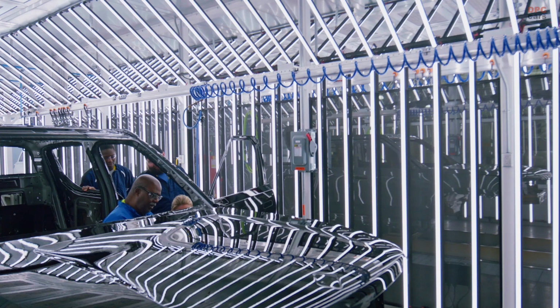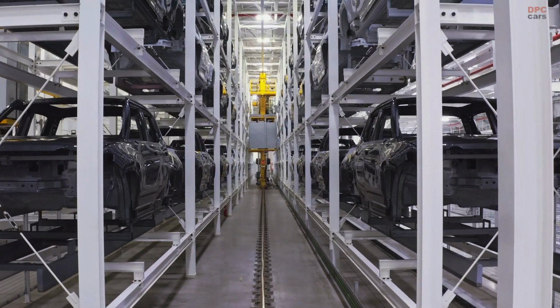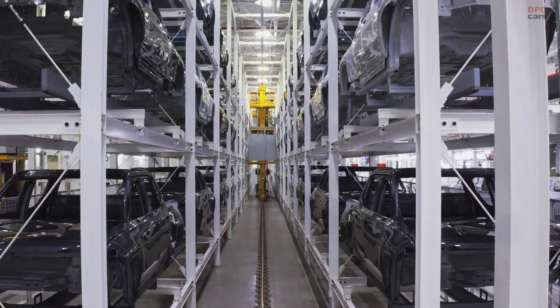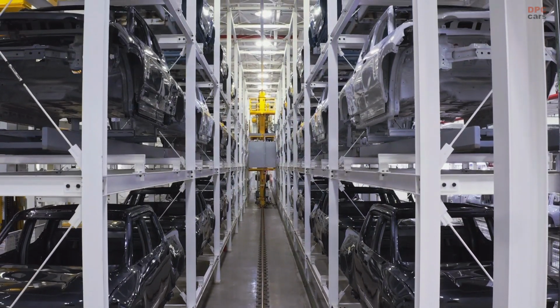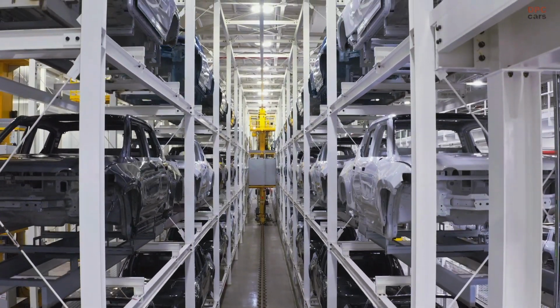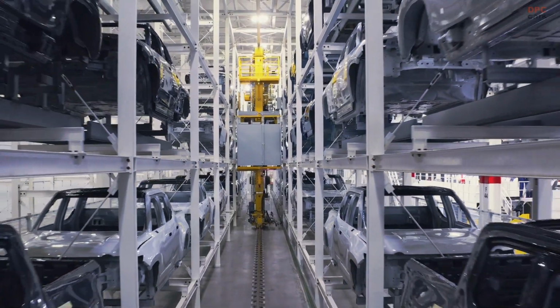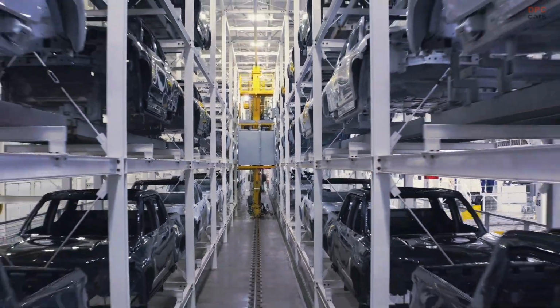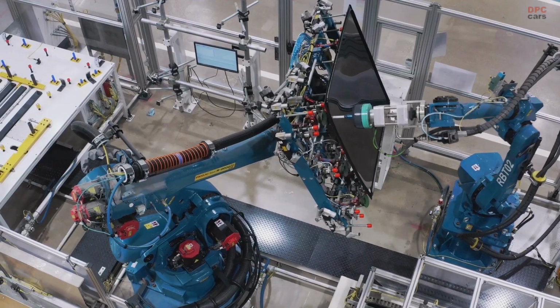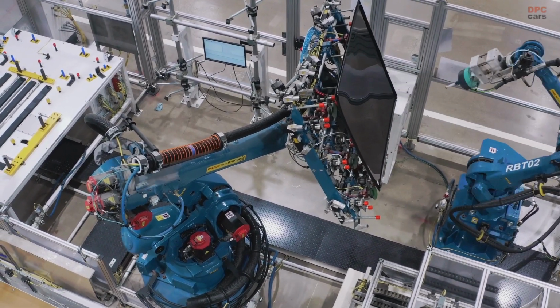And what that battery system is made up of is a series of modules. And you see this module here blown apart. That module carries 15 kilowatt hours of energy, and our biggest pack combines 12 of those. 12 of those 15 kilowatt hour modules for a total of 180. And the way we're able to fit so much energy capacity in the floor of this vehicle is we package the cells very efficiently and managed the temperature of those cells with a very sophisticated thermal control system.